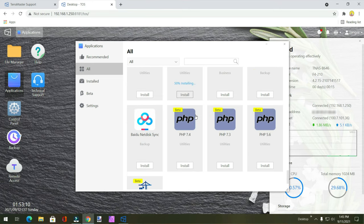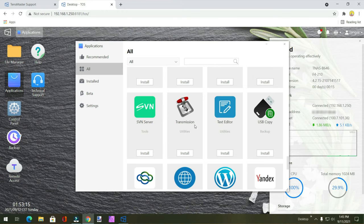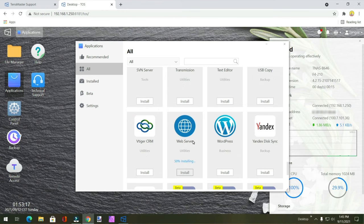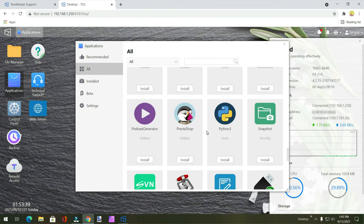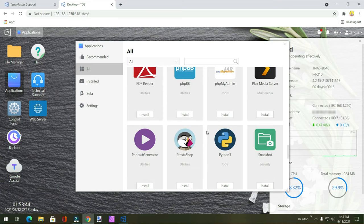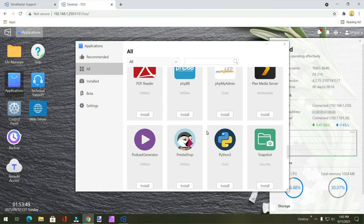That way from home, or I'm sorry, let's say I'm at work, I can log in to not my machine, but my web server. That way I don't take up additional power. Now we're using my system and everything, even though I'm not really doing much on it right now. Again, we're basically sitting on the desktop idle. I am recording, so it's taking a little bit more than if I was completely idle. The 30 watts versus, you know, 260 plus my monitor. Okay, I'm actually using 121 watts, but 30 watts versus 121 watts, big difference. That'll help your power bill.